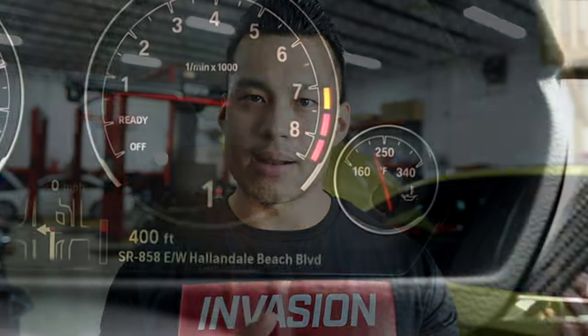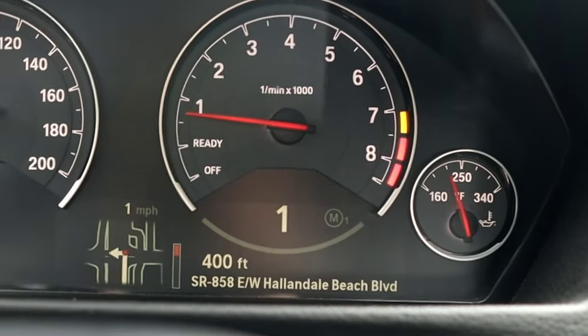One more thing too, the Mosselman thermostat keeps it roughly in a stable range of 100 degrees Celsius. And that's what it's made for. So that's what it does, and it kind of keeps it stable. You can see later on when we take a drive, I'm going to show you my dash, or my cluster, and you're going to see where the thermostat goes to when it's at operating temperature. As you saw earlier in the video, we had it at maybe 2 bars from the bottom, which is where it normally operates, even with the OEM thermostat. So once this is all done, I'm going to show you guys exactly where it lands, and you're going to be very surprised.